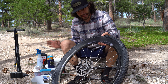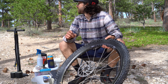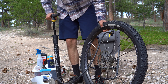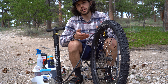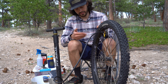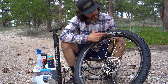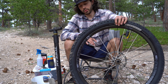Give yourself a pat on the back. Typically the tighter the fit, the better off you are, especially when you don't have an air compressor in the middle of nowhere. So what we're going to do is not put any sealant in yet — we're just going to try to pump up the tire as is. Clearly that worked really well. Sometimes you'll run into more difficulty, especially with an older tire, and you may have to use an air compressor. But I know that Teravail and Industry Nine work well together, especially with a new tire. So now I'm going to seat the bead — there's a line on the tire that needs to be lifted above the rim on both sides, and that's what we're going to achieve before we put any sealant in.